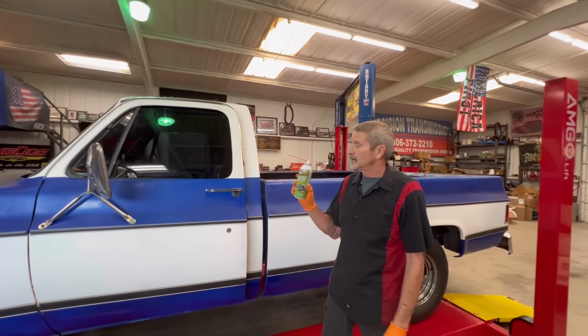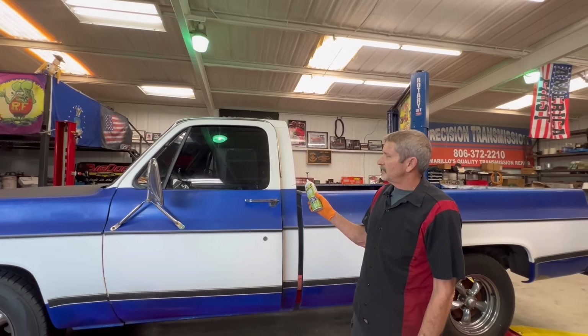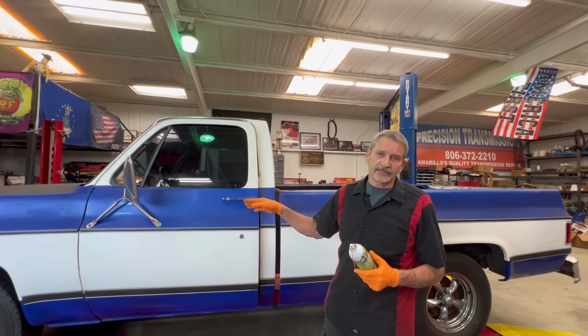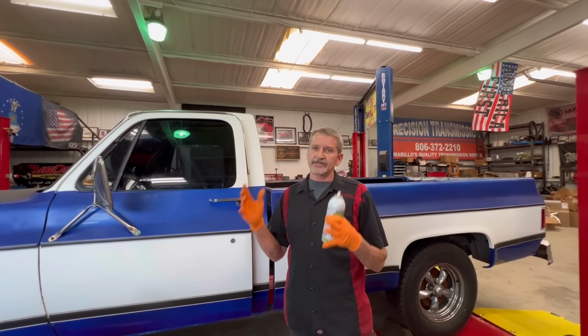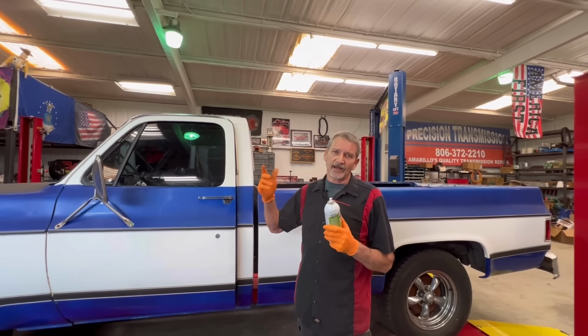We were worried about bigger batteries, bigger alternators and stuff like that. But this truck did not come out with electric windows or any accessories like that. So we are putting a bigger battery in it, and we are going with a 200 amp alternator and getting rid of the 63 amp alternator, because that alternator will barely run the headlights. Now you gotta remember, the battery starts it. Once it gets running, the alternator takes over and runs the vehicle, all the accessories going down the highway. The battery's just taking a slight charge, that way it's ready when you turn the vehicle off and start it again.